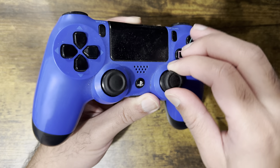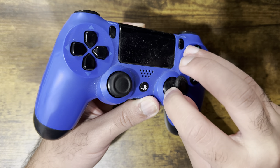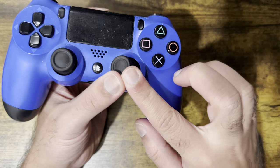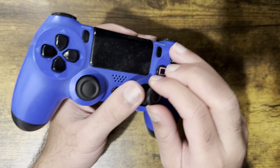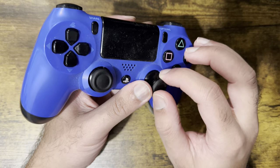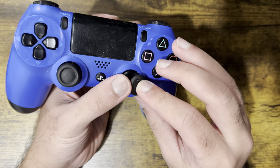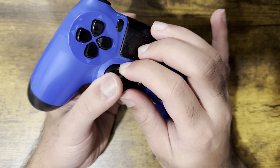The first thing you want to do is take the controller and kind of shift it like this, as I'm doing right now. You'll even see there's like dust and debris inside these portions of the controller. So you want to either clean it with your hand, or the better way is to clean it with an alcohol pad wipe. That fixes a lot of these issues. You want to make sure you go in, and the reason we're using alcohol is because it'll easily dry up and won't cause any water damage to the controller.